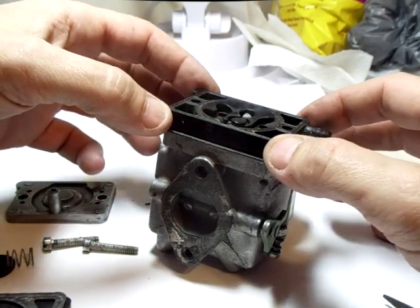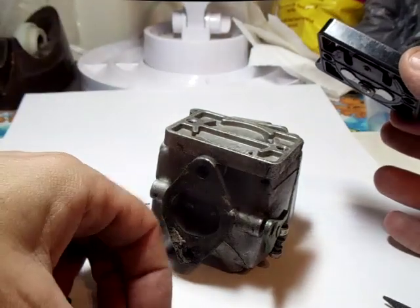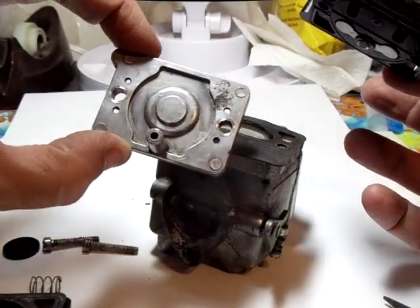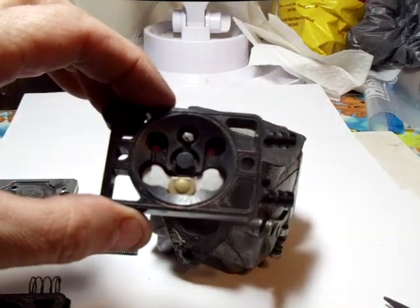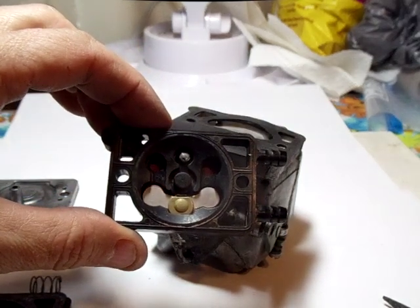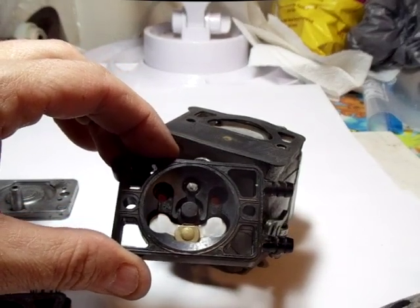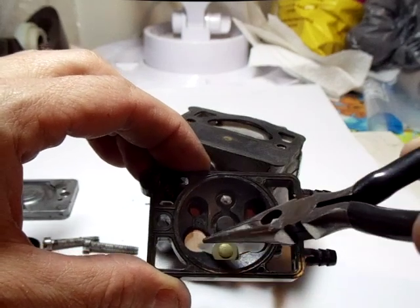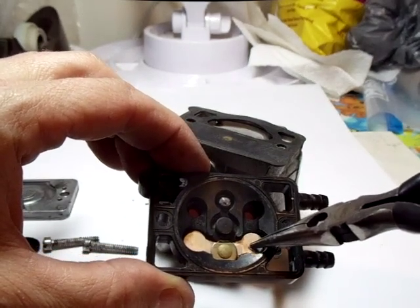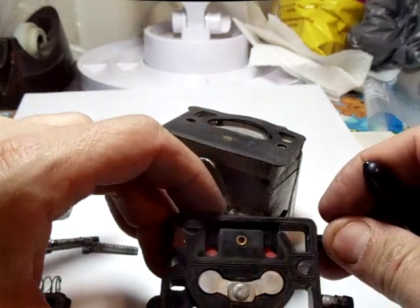The main body of the fuel pump is removed next, followed by the last gasket. It's easy to know the order of the gasket because the gasket has a little tab that aligns with the tab on the carburetor, and all the way up through the cover. Here's the fuel pump innards, and what you'll find a lot of times — and I know this because I've had a number of Onan engines over the years, and they all develop these problems on their own, even with newer fuel pump kits — you'll find that these reeds, which are basically vacuum operated off the engine, they flex a little bit and let the fluid through, but then they spring back to almost closed. You'll find reed valves on this side and over here as well.